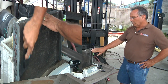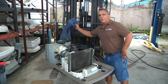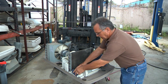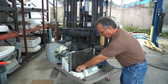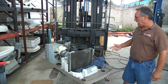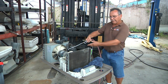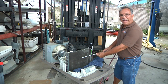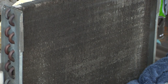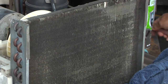Normally they're not this dirty. Once we've taken the heavy material off, while this is up on the roof I'll generally take a towel and plug the hole up so we don't get any residue inside the coach. Once they're this dirty, I'll take compressed air — an air hose — and I'll blow from the back side. You always do it from the back side; you don't blow it back into the coil, you blow it back outside. Get as much of it off as you can before you put coil cleaner on there.